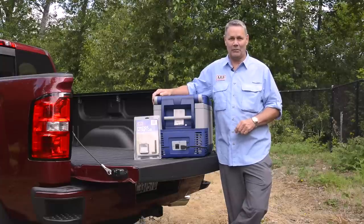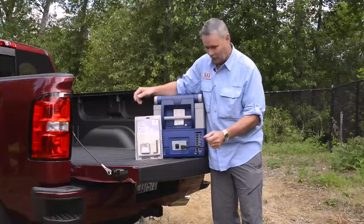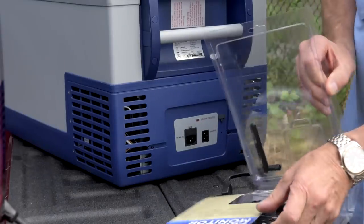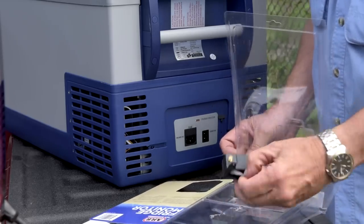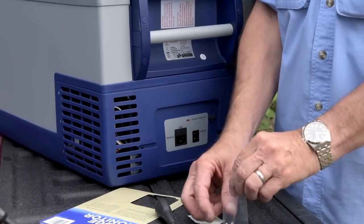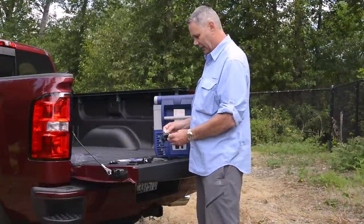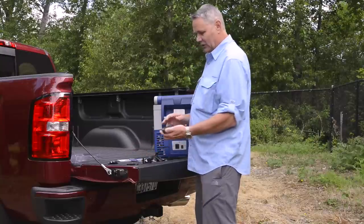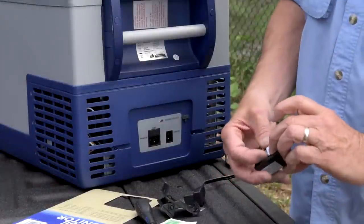If you had the remote sensor you'd be able to see at a glance if the fridge is on and what the temperature was. To alleviate that problem, I'm going to show you how you install it — very simple. As mentioned, there are two Phillips head screws and two prepped holes in the back. First thing we're going to do is disconnect the power and take it out of the retaining clips. Here's our monitor, antenna, head unit, power supply, and base for the antenna. We have an alcohol swab for wiping down the dash.